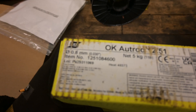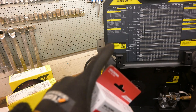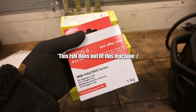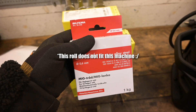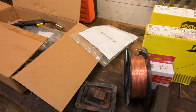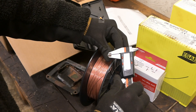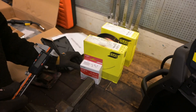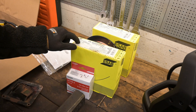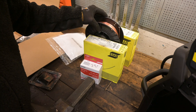In addition to that, I bought a spool of another 0.8 mil. And to weld the thinnest material that this machine can do, I bought a spool of one kilogram, 0.6 mil wire. I'm not sure about the gauge of the wire that was already in the old MIG welder, but we can figure that out. Turns out it's 0.9. So then we have 0.6, 0.8, and 0.9. I think 0.8 is what I used the most when I had the other MIG welder, and apparently some 0.9 as well.